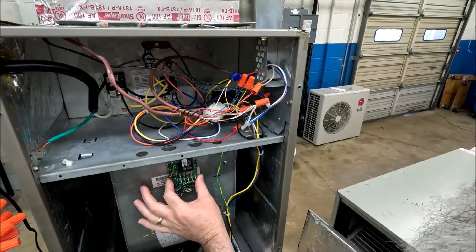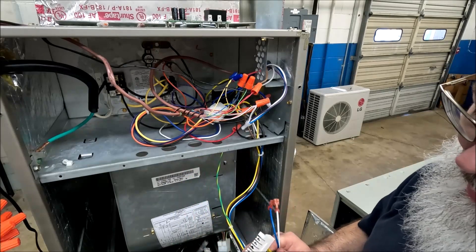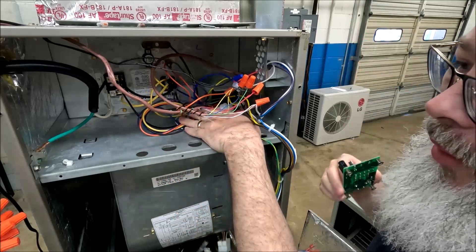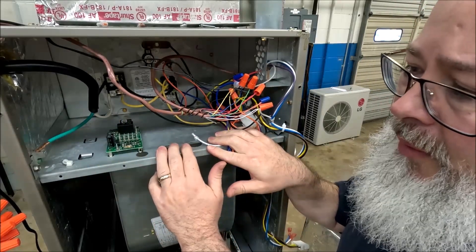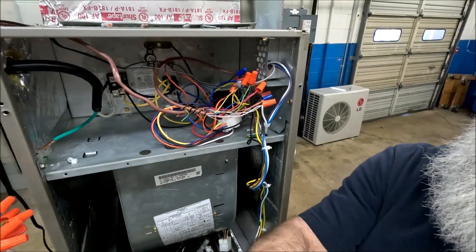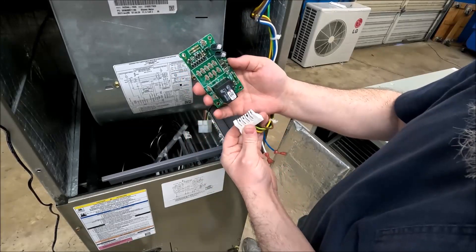I would not want to mount this board down here at the bottom with the wires bent around. You'll notice there are holes cut in the top service area, including a rectangular one. You can take these wires and run them back up through that opening to the top area. You could leave the ground in place or relocate it, then mount the circuit board up on top of this shelf and secure it with a couple of self-tapping screws so all the wiring stays up top. Then you plug in the neutral, ground, and L1 connections with the common straight into the board.